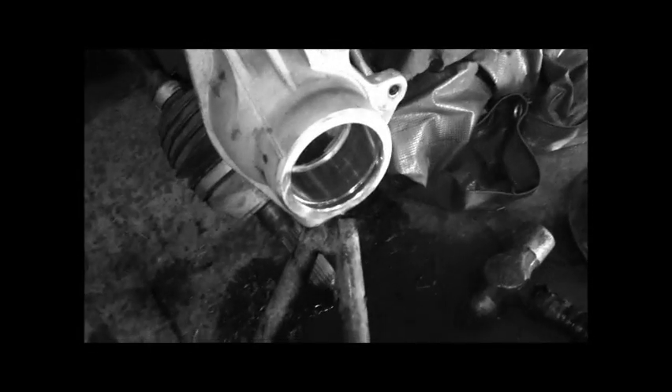I know it might not be the best for the bottom control arm, but also for the new bearing I can always use a press and press it in. I've got a little handheld — not a press, but it's kind of like this where you bolt it in and when you bolt it, it pulls in the bushing or the new bearing. As for the back, I'd have to get some big washers — I'd have to cut the washers, but I'll probably end up just smacking it with a hammer.